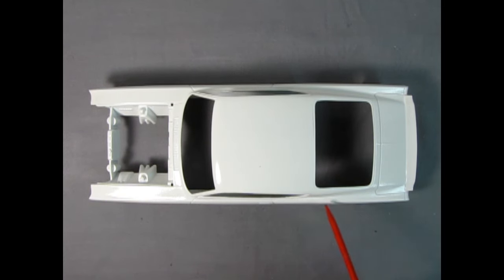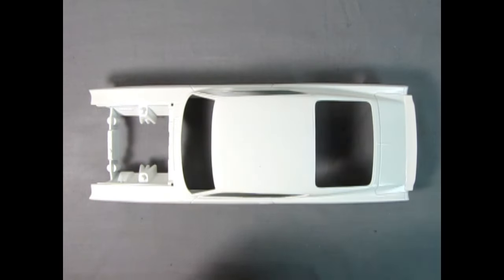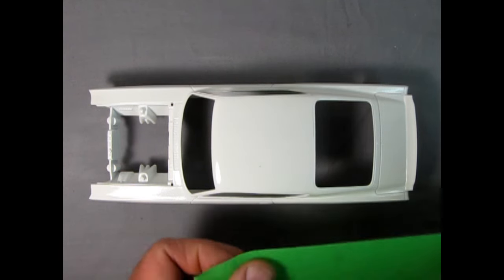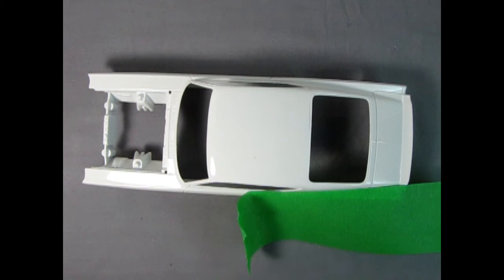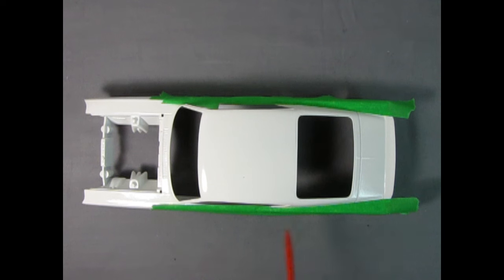I want to sand the little bits of junk out of the roof and the sides and the back because I want the entire roof to be a different color, but I still need the side areas to remain white. I don't want to scratch that with sandpaper and destroy the glossy finish. So I'll take my cheap masking tape, rip off a little bit, and carefully lay it down so that I don't sand into the top of the fender. This is a good way to protect against sand scratches before replacing the tape with better masking tape for painting.